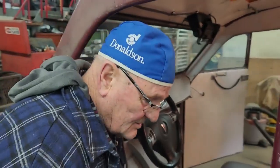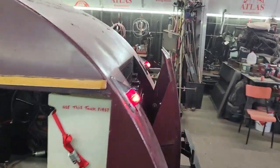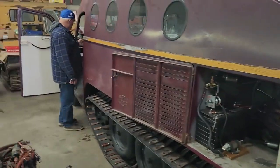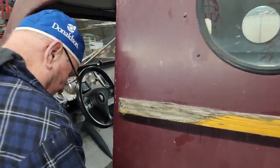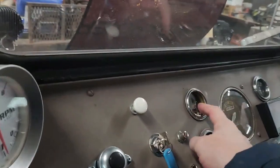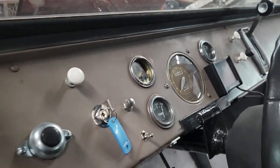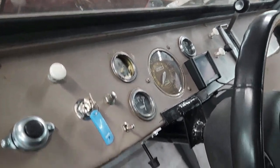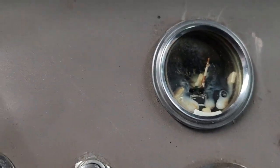K lights. We're working. I noticed that yesterday, I just thought it's okay. And it's got a little bit of heat on it too — it's shorting out. It's shorting out and burning the wire, it's not doing anything else. That's the only one that's hot. Which gauge is this? It's melted completely.